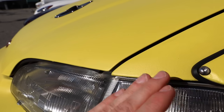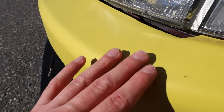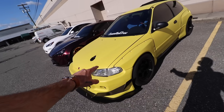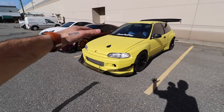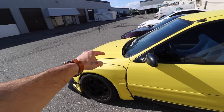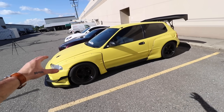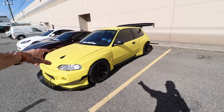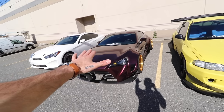The finish on dip is okay. Dip is a bit textury — it never really feels smooth. You can see it looks a little orange-peely. There is a clear you can put over dip, but the clear makes it even more ripply. So this is the dullest car of the three because I skipped the clear. As for durability, I'd honestly say dip is the most durable. I've banged doors off things, taken rocks to the hood, and it's held up. The longevity though — this stuff apparently doesn't get you more than about two or three years before the quality really starts to deteriorate.